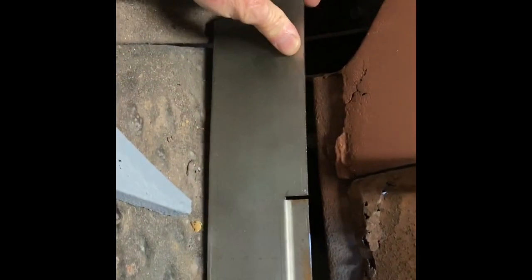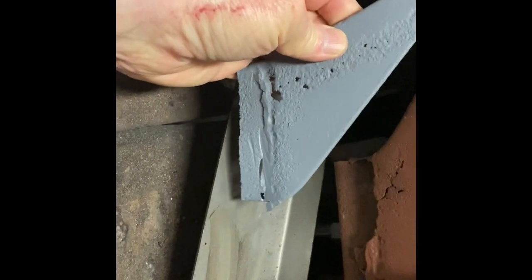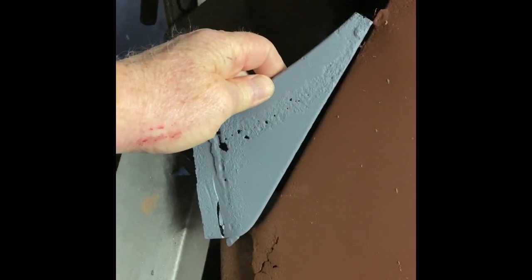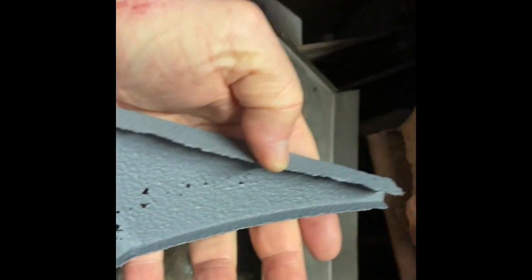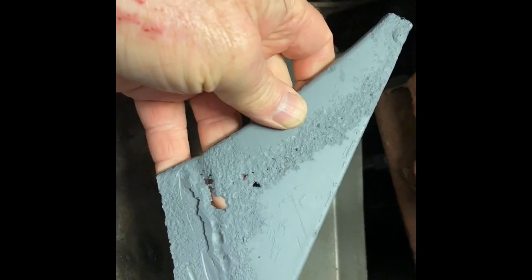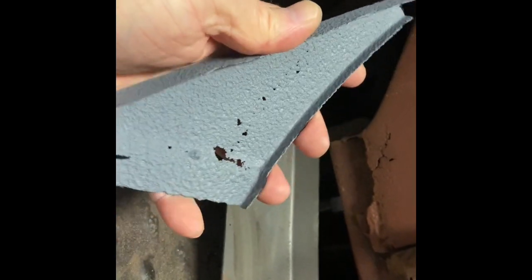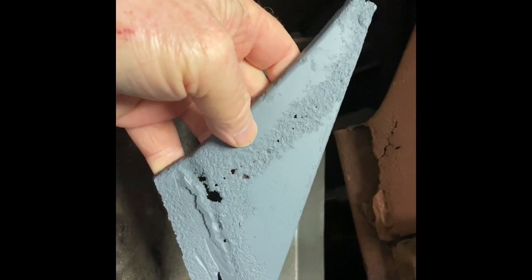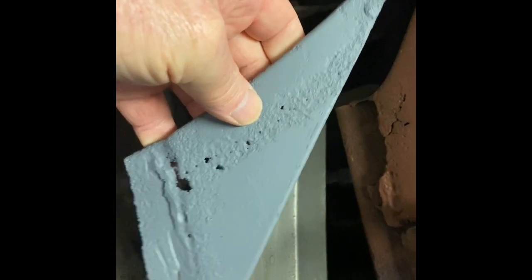So, brand new rocker panels. I'm gonna try to use the little kick-up pieces here. I got all the rust off with the vapor rust and immediately put some primer on it so it wouldn't rust again. But I don't know whether this one is worth it. I can put some fiberglass in there, reinforce it, and some bondo. Or I can try to replicate that. We'll see if I can do it.